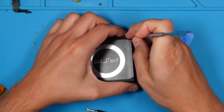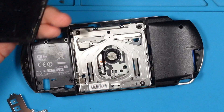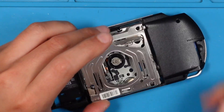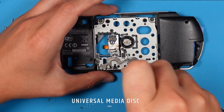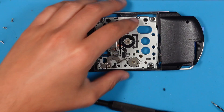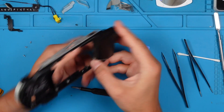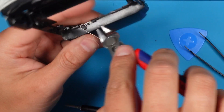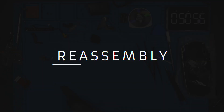To remove the back plate it is necessary to pry from both sides. The prying isn't over yet — the metal part of the disk drive needs to be removed in the same way. We can now see the inner workings of the UMD drive. To completely free the drive we need to remove four screws and lift it out of the case. There are some rubber damper rings that we don't want to lose. For easier removal I cut some of the plastic with a side cutter. The disassembly process is complete.